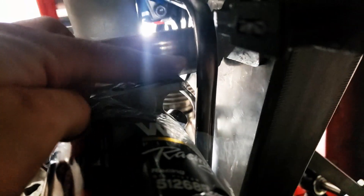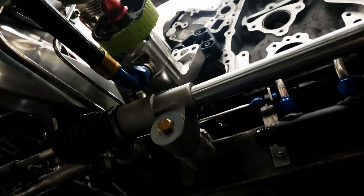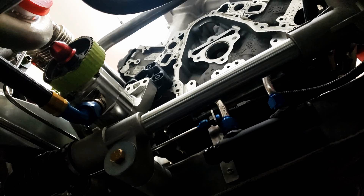Lying on my back here, I've got turbo drain number two. It goes underneath the filter mount, over the rack, back against the cross member, down to the fitting manifold. This guy still needs some sort of mount to tie it tight to the cross member so it doesn't wiggle around. I ordered another NASCAR takeoff PTFE hose. We'll have a PTFE hose running from this manifold to the first scavenge stage — a 120-degree fitting out of the manifold comes down and runs to a 90, nice and tight fitting to the side of the pump inside of the rack, staying out of the way of the balancer and the dry sump pulley. This is looking pretty tucked and I'm pretty happy with how it's all looking.